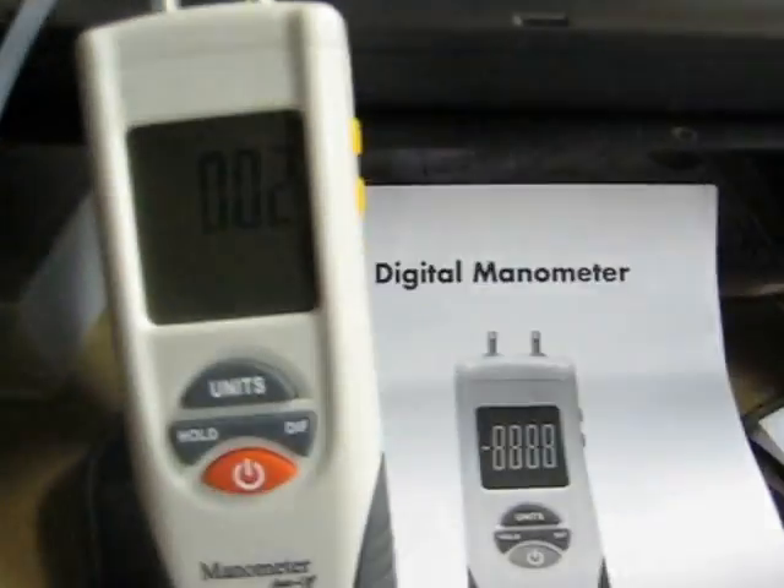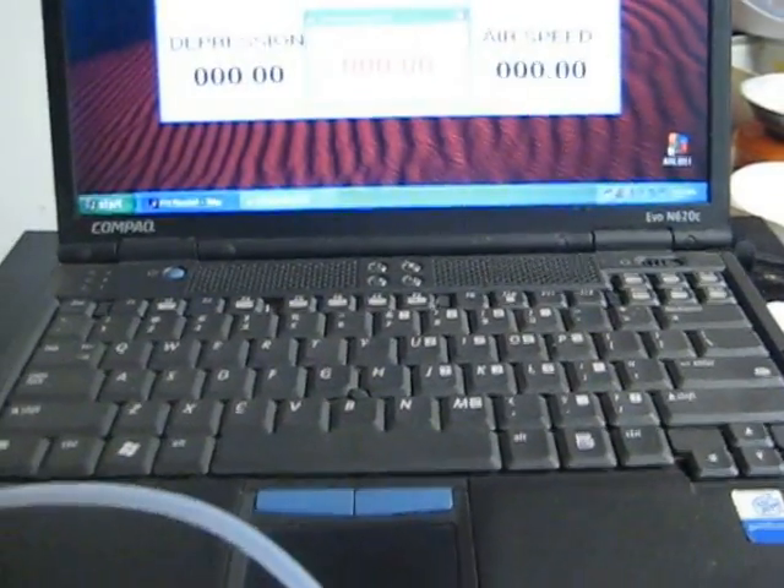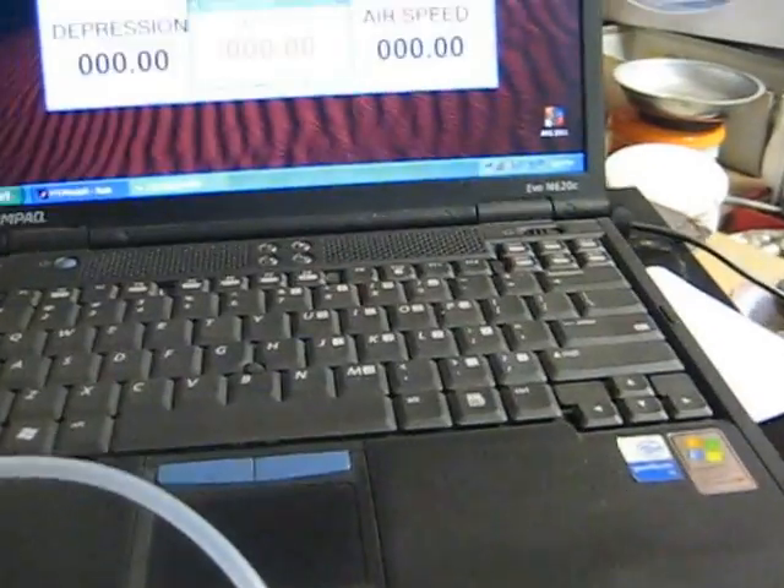Based on that test, I think we can confirm that between the three instruments — an actual water-inch manometer, the unit I just got from overseas, and the PTS flow software equipment — all three are in agreement. It's hard to get anybody to agree nowadays, but here we have three different instruments, one of them homemade and two professionally made, and they all agree that we're pulling 28 inches of water.